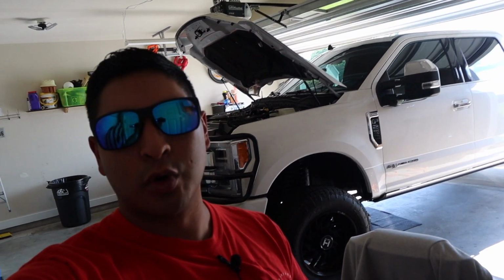The cooler we can keep the transmission, the better. You know, with the added quart capacity that these aftermarket pans actually provide, it's going to take longer for the fluid and transmission to warm up. It's also going to take the transmission that much longer to cool down. All that said, I'm going to go ahead, get underneath the truck, start removing the bolts off of the transmission pan, and go from there.